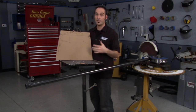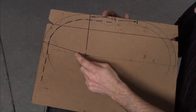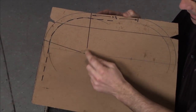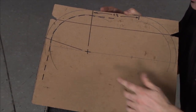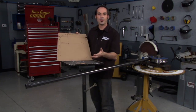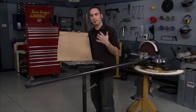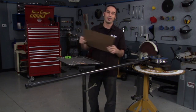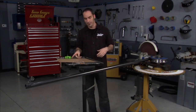Piece of cake. Now if I'm smarter, I can measure my angle, so tangent point to tangent point. This is the arc that I'm going to bend. I can measure that about 82, 83 degrees. I can lock it right in here in this machine and sweep my arc pretty much first time. I may want to back off just a couple degrees and check it. I can check it to the car. I can bring my template over and get it rolling.